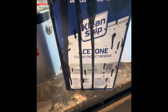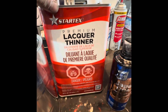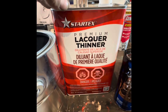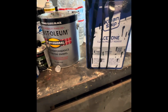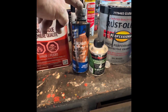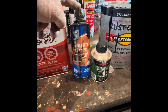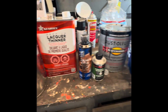I was using acetone at about 25%, but my brother-in-law, who's a professional painter, said I should use about 20% lacquer thinner. So we're mixing this thing up and that's what we're using. If you ever wanted to use Rust-Oleum, that is what you can use — those are the items. I got the lacquer thinner at the local Sherwin-Williams, or actually it was RADA paint. So that's what we use.